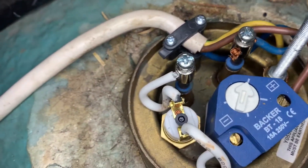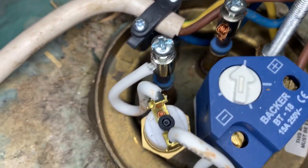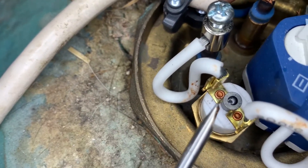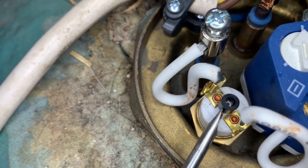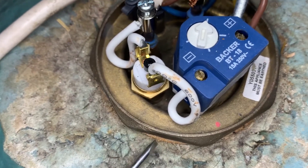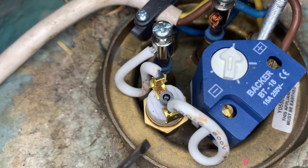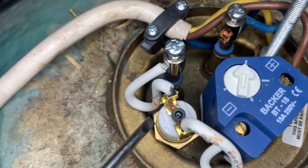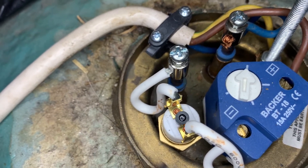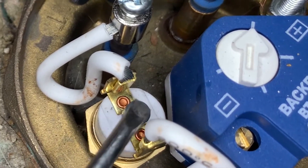That exposes the wires. My problem was this tiny little thing here, which I found out was the trip switch. What I'd done is left it on for too long, and the water inside had got so hot that it was going to create some damage. But the trip switch tripped, so no damage would occur — it stopped the whole heating element. When it trips, this little black thing here pushes upwards.